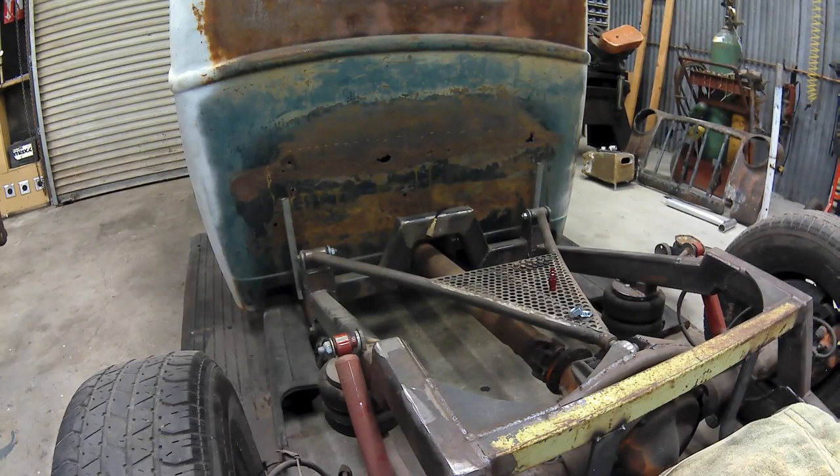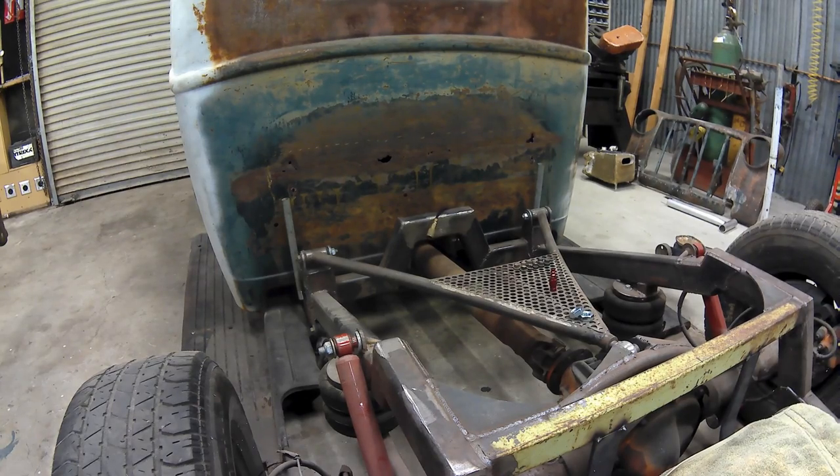So it is possible to design and build a reliable air ride system. Take into consideration where you run your air lines and your wiring, how you install your airbags, the quality of the parts that you use, and do your maintenance regularly.